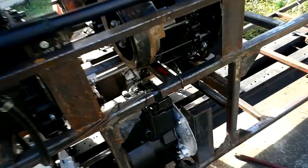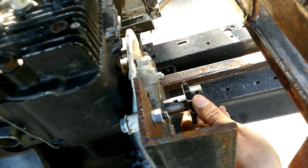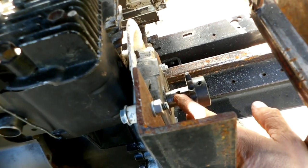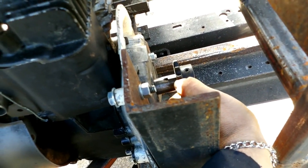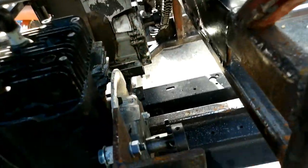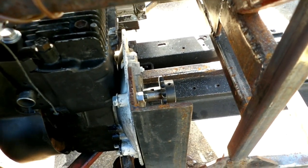Now I go down here to bottom row 3 — this cylinder — and he's at the top on compression. The key is at the top on this crankshaft. Some of them are actually opposite, but I put a mark on to indicate when it's at the top, and you can tell because it's got equal drag on both sides. So I just wrap my chain around the sprocket up there and around here, as tight as I can get it, and that cylinder will be timed to fire at the right point in the firing order.